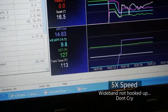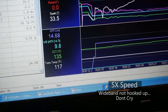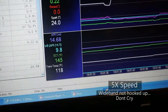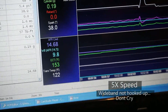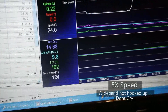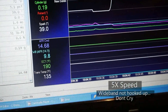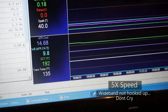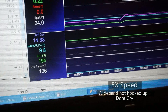So what I'm going to do now is hook up the scanner, start it, get it up to like 210-212, and then turn the fan on and see if the temperature actually comes down. If it starts to come down or holds the temperature there, I'll be pretty confident with it. If not I may need a bigger fan. I kind of just threw the thing in — it's temporary — and if it works I'll button it up good. I do want to redo all the wiring eventually. Let's get started and see if it works.